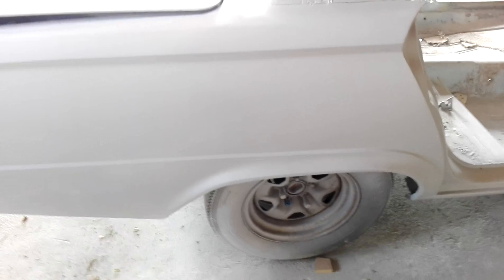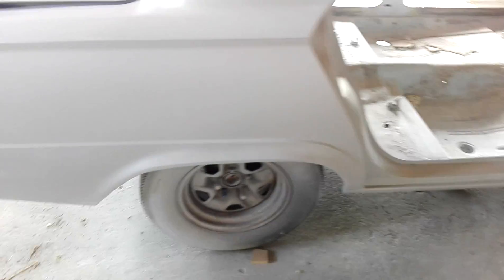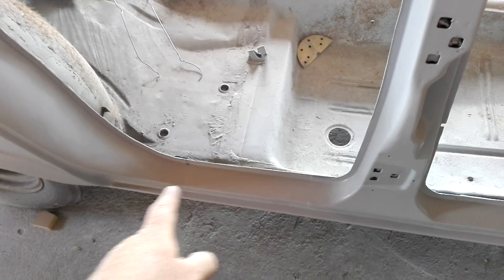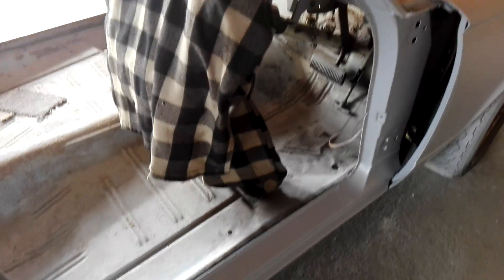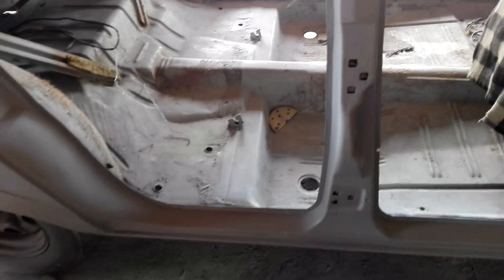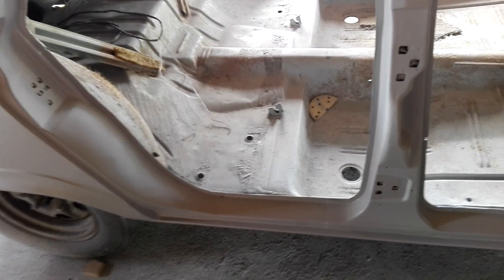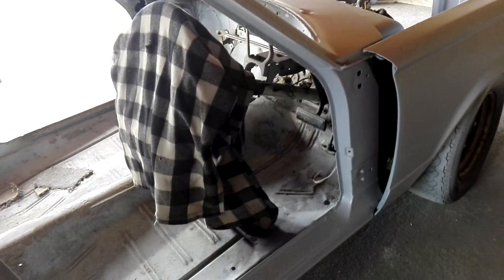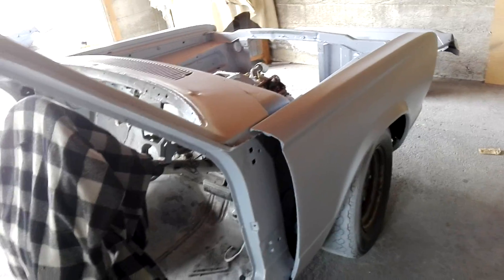I'd had the shape a wee bit wrong. There was plenty of filler in there so I just reshaped it a wee bit. And the same in here — we've hidden most of the seams. In spots it still needs a little bit of filler, but it's a lot closer than it was. It's basically just general tidy ups now, and when we're getting closer to final prime, we'll give it another good couple of coats before we get into the final sand back and all that sort of stuff before paint.